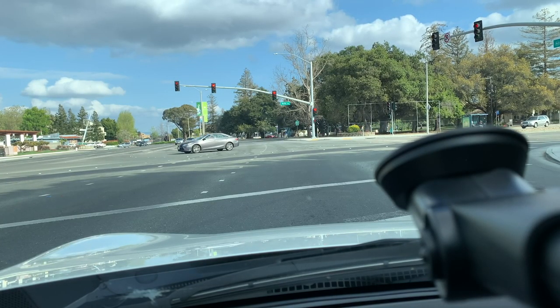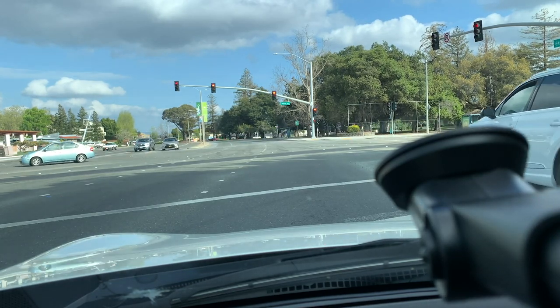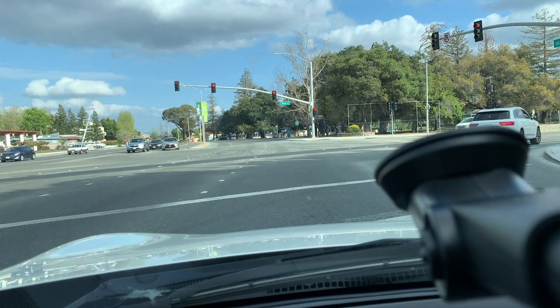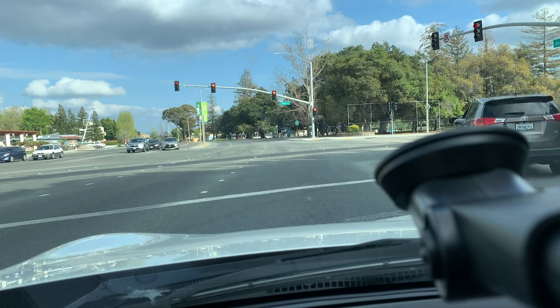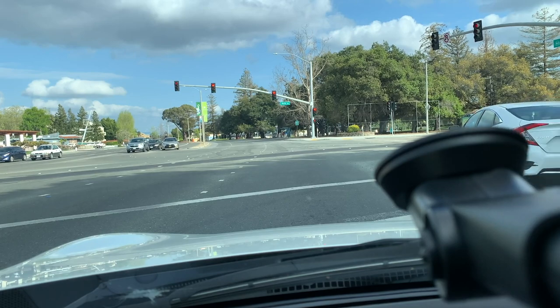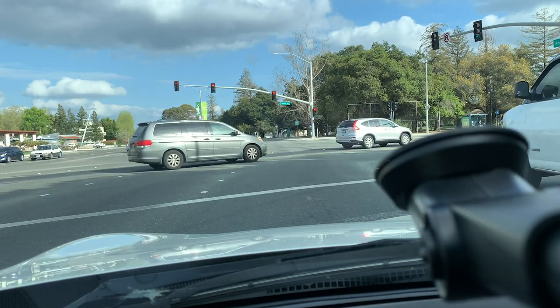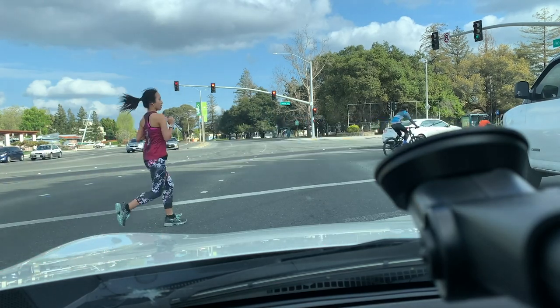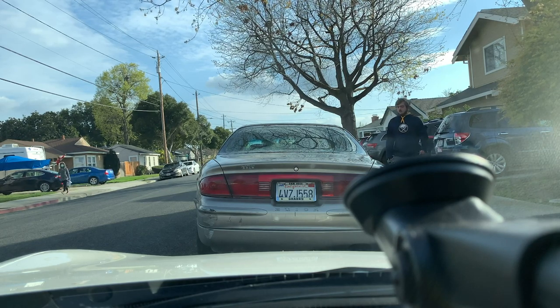People talk online about lightweight solid crank pulleys because they don't have a harmonic balancer or the rubber piece that kind of softens the blow. They say in time it could damage other parts or wear out other parts faster, but I wonder how much of that is true. In any case, yeah, it's already on there, so I'm not about to take it off again. So, should you get it? Yeah, why the heck not?